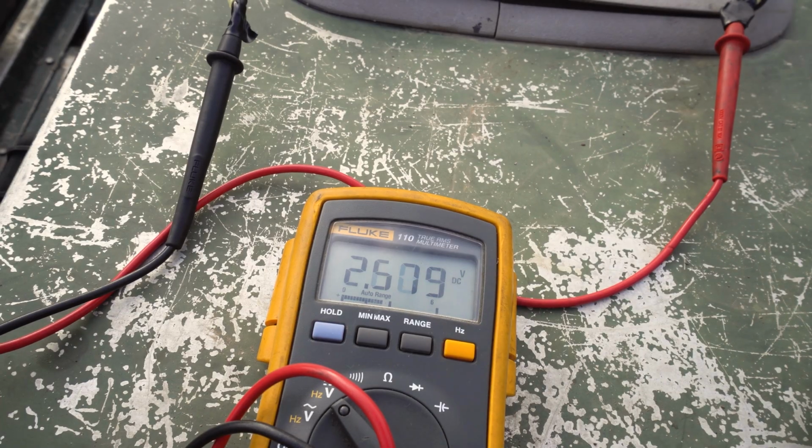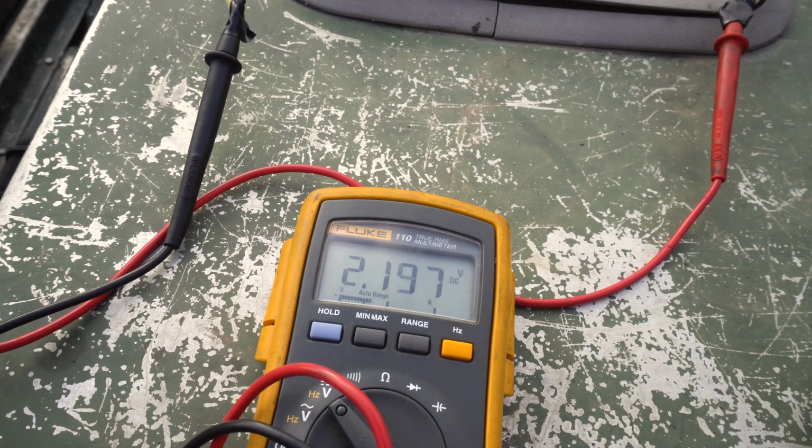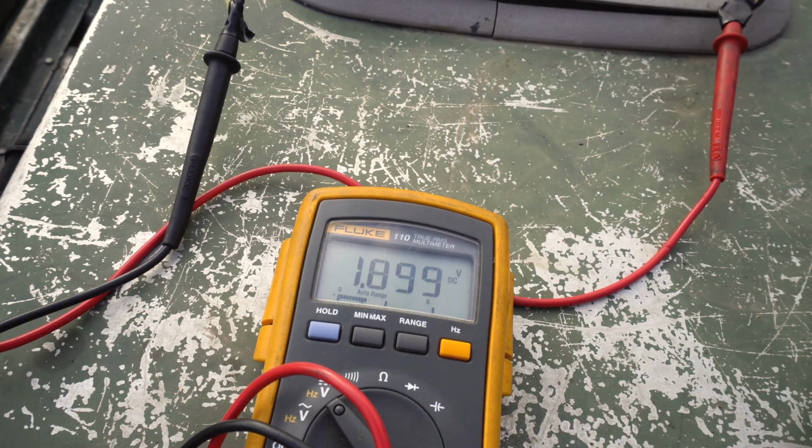It needs at least, so usually when it comes to charging, you need at least 13 volts. At least 13 volts to charge anything. So we'll see. We'll bring the voltmeter with us. We gotta go get it under the earmuffs again, and we're gonna have to crank it up and see what kind of voltages we get. I was just kind of messing with it, but even before we fire it up, there's a little bit of voltage on the lines already, which is okay. But as I'm pulling it, I'm not pulling it fast enough so I can start it.